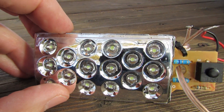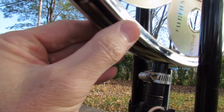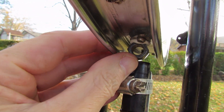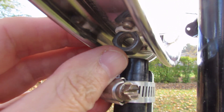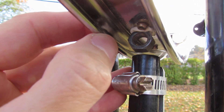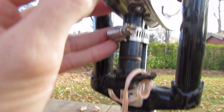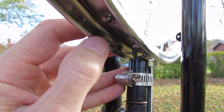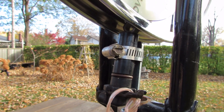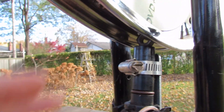You can see that each time — I'll stop this wheel so I can show you — there's a nut mounted right to the rim. As it passes this crank sensor, it creates a voltage spike and sends it off down that wire to the LEDs and illuminates it. When this is going good in the wind, this LED flashlight is really flashing really well.